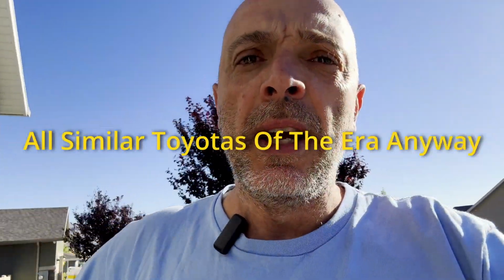electrical system. See what happens once the ignition of the car is on and your control unit is on. What the control unit does, it will consistently send a signal throughout the supplemental restraint system, all the sensors and all the airbags, to assure that the closed circuit electrical systems of the airbags and of the accelerometers are actually connected. And as you move that seat back and forth and the wires touch that lip that I just showed you, which is also present on the passenger side, it somehow creates a disconnect and it gives you a fault code. In this case, for the Toyota Solara, and I believe it's also for all other Toyotas, you get an 1821, which is for the left side, and an 1826, which is for the right side, for the passenger side.